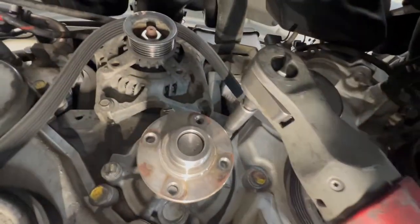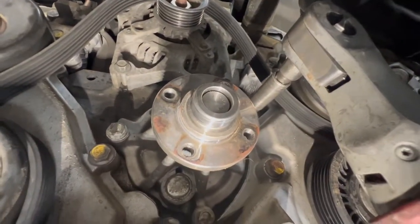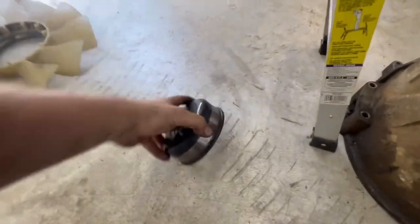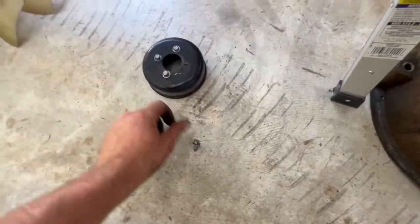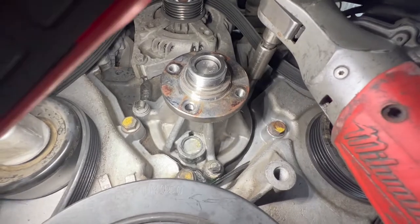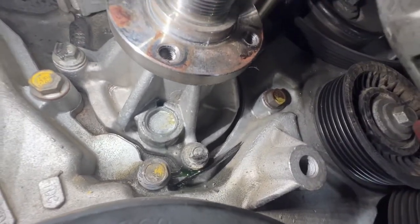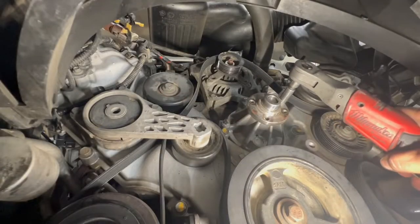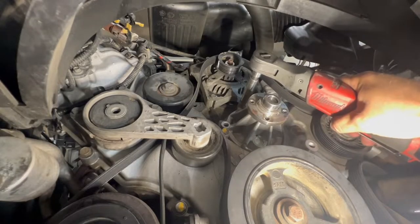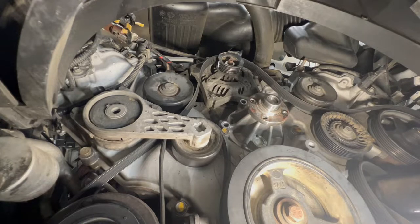So now we're going to bust our four bolts. And if you notice, that pulley has about a little groove on each one of the heads of these bolts — I've never seen that on one of these. It doesn't seem to have damaged the pulley, but you can see where it was weeping out of the weep hole there. And you can see this bottom bolt has got some corrosion on it. So let's get this busted off and take a better look at it. You don't get all the coolant out when you drain it, so when you bust this off you're going to kind of make a mess, so get a catch pan and try to catch what you can.